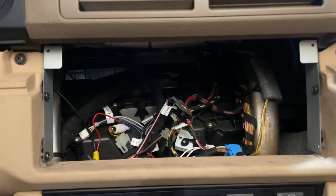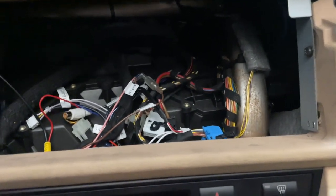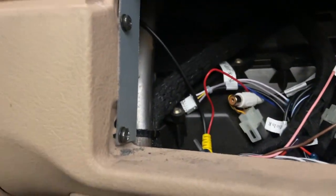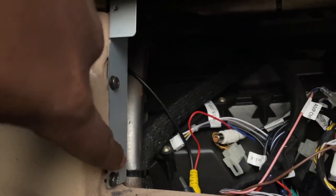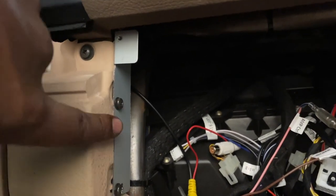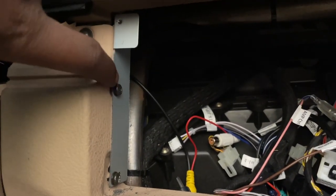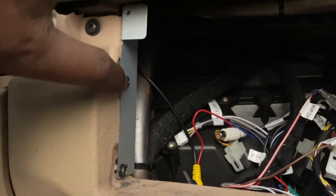bracket. So I've gotten the brackets lined up now. You're going to want to remove this hardware actually from the stock unit. You're not going to use this at all. You have to drill into the dash a bit. You have to move these a bit down below. So unfortunately, these brackets won't actually line up directly with the stock holes because of how it's designed. So you'll have to drill into the dash with these original screws that came with your car